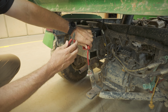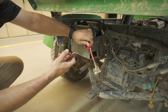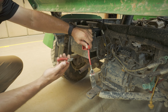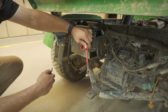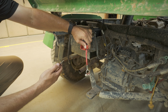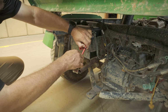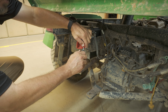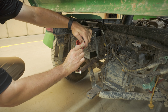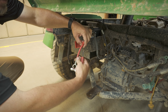If you don't have a pair of flush cut pliers, they are super handy. You can't cut anything big and heavy with them, but I just use them for zip ties. And it's definitely a big pet peeve if I'm working on something and I cut myself with a zip tie because somebody used a pair of side cutters or diagonal cutters. With flush cuts, if you cut the zip tie off, no sharp edges there. You don't get that with other pliers. So anyway,